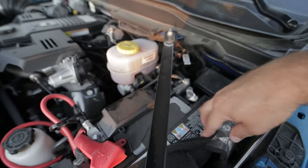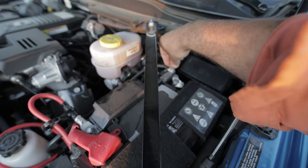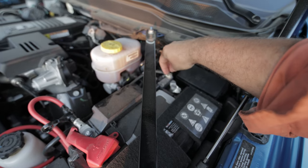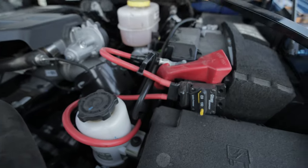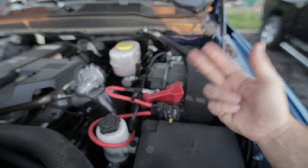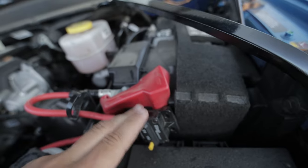Check your battery to make sure you're hooking them up right — 99.9% of the time your red wire is your positive. My kit came with pre-pressed lugs from the factory. I took the nut off, put the lug on, added a little contact grease, and tightened it up. The positive side is different because to make this safe you need fusing or a circuit breaker, so if your unit short circuits it will draw enough power to trip the overcurrent protective device and not burn your truck down.